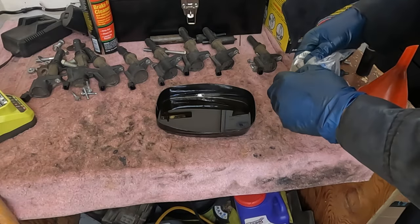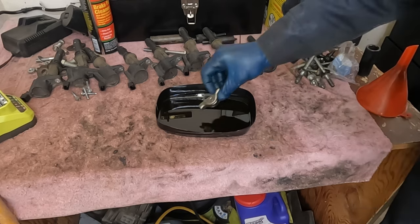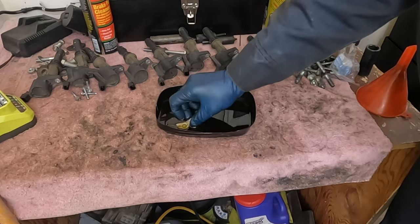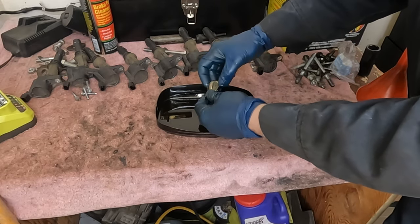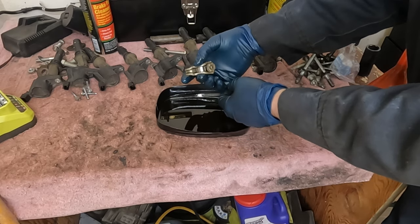Prepping the new followers: pull them out of the bag, sit them in a tub of fresh oil, get them all nice and soaked, then move that roller around a little to get those bearings lubed up. That's it - put them one at a time back on the vehicle.